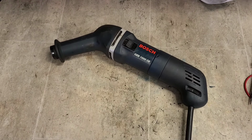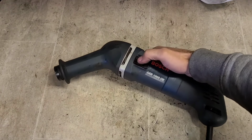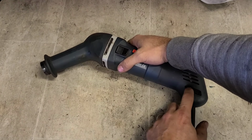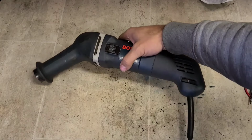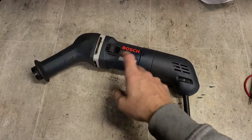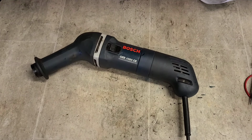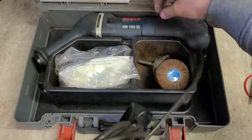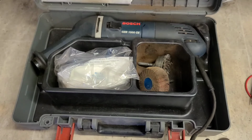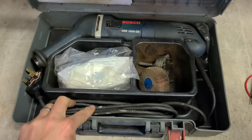See if it sounds any different, because I never actually took that out. One of these screws was actually loose, so maybe it wasn't putting enough tension on one of the bearings. That's her. That's as much as I can do. I don't think that sounds exactly right, but the bearings aren't gone. Armature still good, so unless the gears are just starting to wear. But I would say it'll be hard to get parts for that thing now. Running. The customer can keep using it. That's the main thing. By the looks of it, this thing doesn't get taken out too often anyway, so that'll keep this boy going.